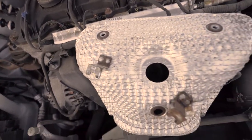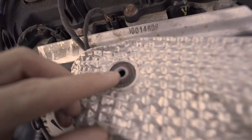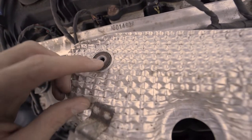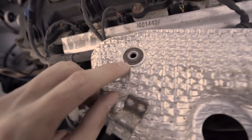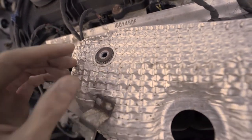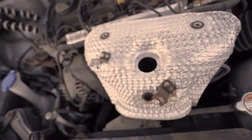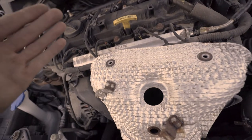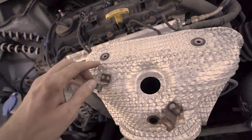With the heat shield off, here's the heat shield itself — it sits on the exhaust manifold. You'll notice it has these washers in between it, and one of the weird things is it has a wire mesh that holds the washer in place. Over time this wire seems to just go bad and allows the washer to move, which is why you get this awful rattling sound. It doesn't affect the performance of the car, but it sounds terrible.